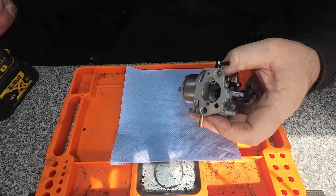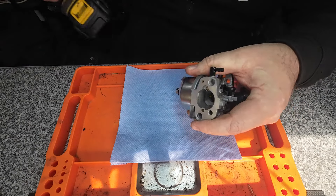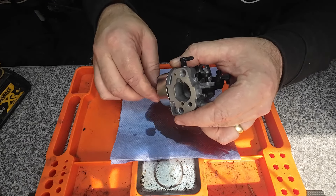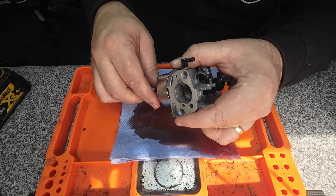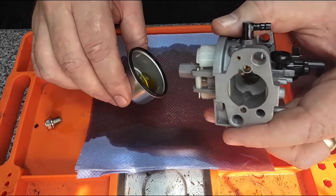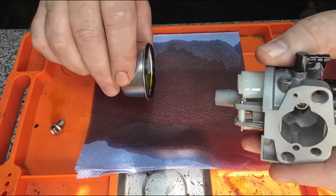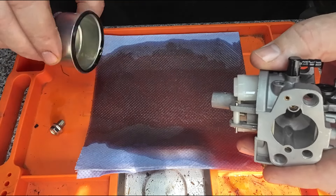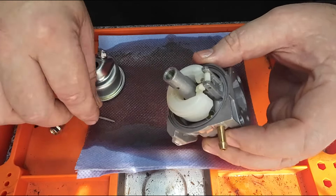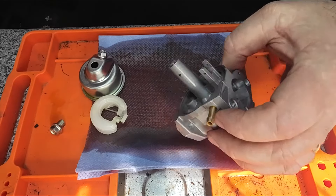Carburetor time — 10 mil — let's loosen up the bowl. I can tell by the state of the fuel that it's actually gone off over winter. This is a classic case of fuel left in a machine over winter. You can see how yellow it is — it looks like a urine sample. That's the reason why this lawnmower is not running — the fuel is over 30 days old. I should have drained it out and I didn't.